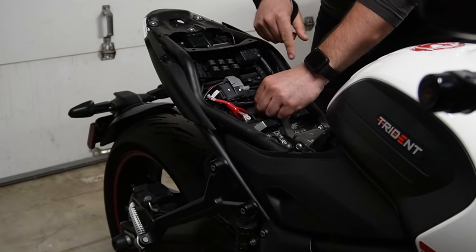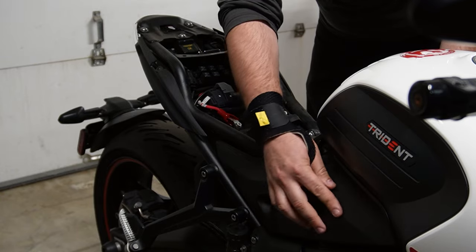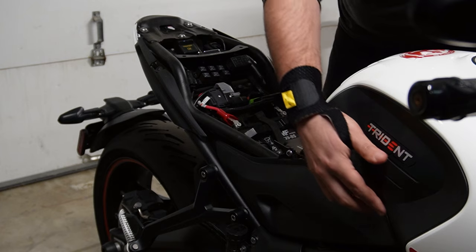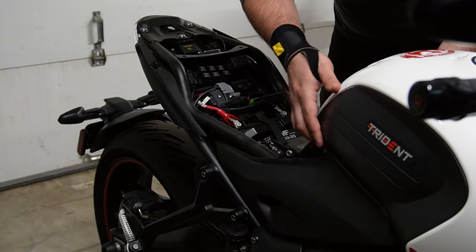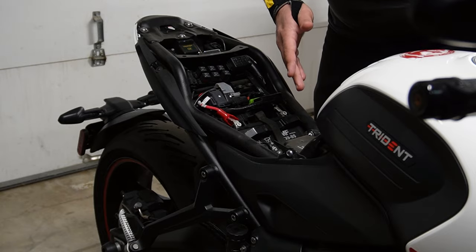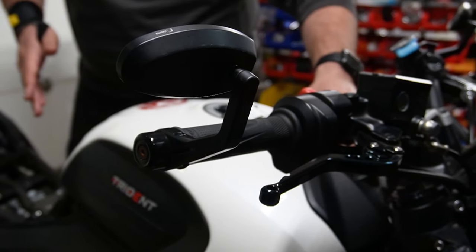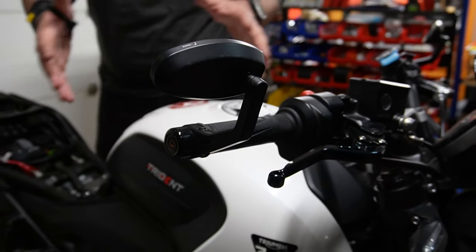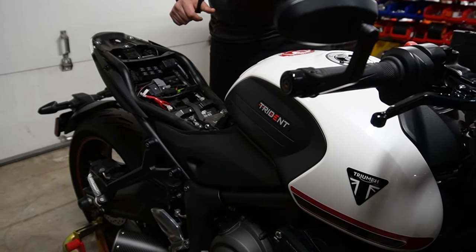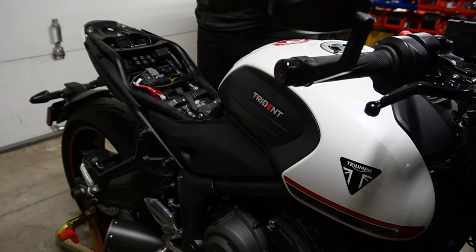So for the battery removal, there's just a little rubberized clip here. Pop that off very easily. Then these will come out. There's a couple of screws and then some plastic grommets. Then we'll release some screws around the bottom of the tank. And of course, there's this little bib up here around the key. It'll be hard to see at the moment, but that'll be the last component until we put the tank to the side and replace that air filter. Great. So just like a lot of other sport bikes, it's right under the gas tank. Pretty much. A little bit harder to get to.